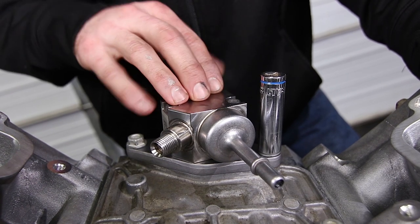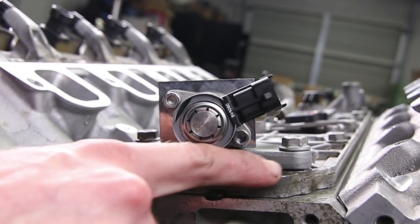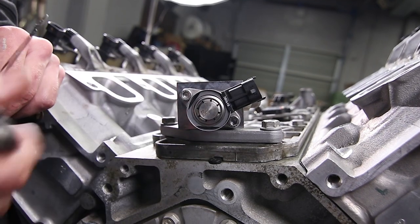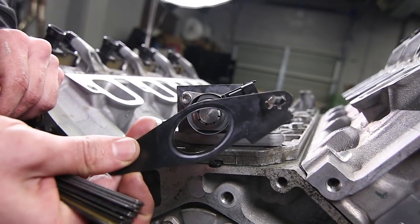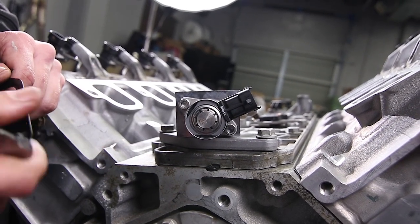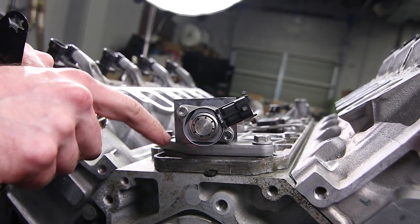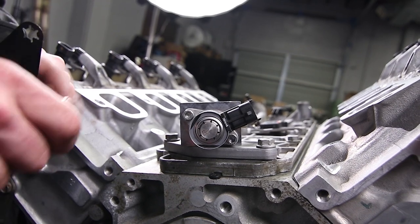Now we're going to show you how to fix this if you don't have the proper clearance. If you end up with a situation where there's a gap below your fuel pump, you want to take a feeler gauge — we'll have one linked in the description — and determine the thickness of that gap. If you're less than 12 thousandths of an inch, you're in good shape because that's the thickness of the gasket. However, if it's more than that, you're going to want to go to a smaller fuel lash. I'm working with an 80 thousandths fuel lash, and the next step down is a 60 thousandths fuel lash. You can also machine your existing fuel lash down to get exactly where you want.